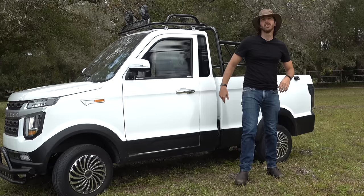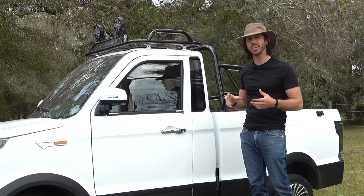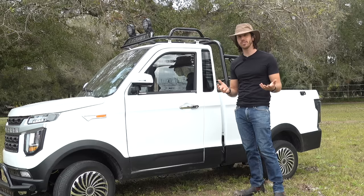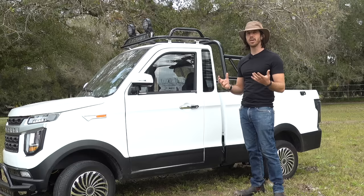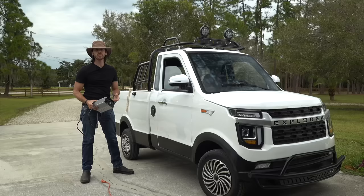There are a lot of updates I want to do to the truck. One of the big things I'm excited to do is put a solar panel on the top — just going right on top of the sunroof, something like a 30 to 50 watt panel. It'll trickle charge whenever it's parked outside. The wall charger is about 1,000 watts and charges pretty quickly, but if it's parked outside all day you might as well get a slow trickle charge. If you're only doing a few miles a day, you can basically always keep it topped up from the sun.